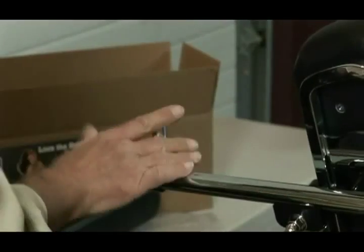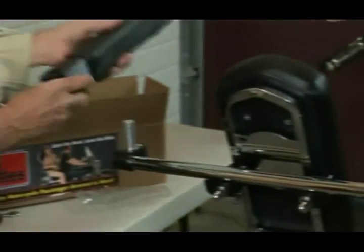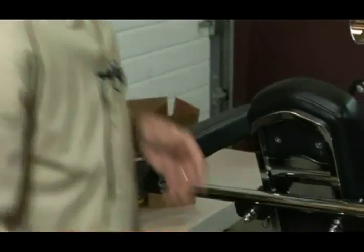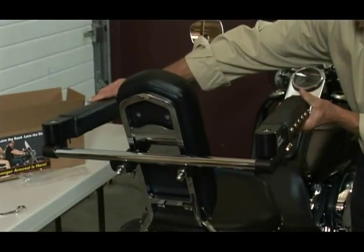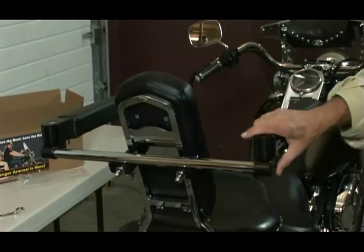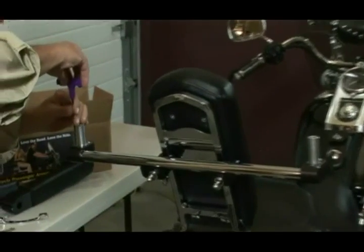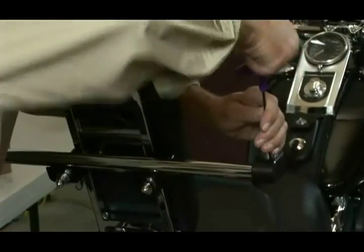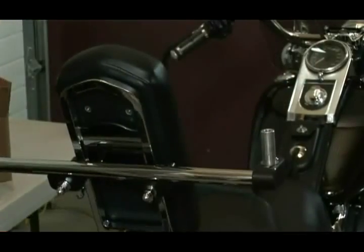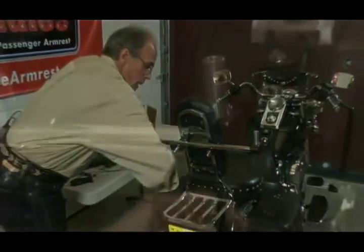Those are tightened a little bit. We'll put on the right armrest and the left armrest, and walk over to make sure that they're parallel. You can adjust them up and down because only one of those set screws is very tight. Now we're going to take the armrest off and tighten the other set screw very tight, so all four of these set screws are really clamped in there. They actually have a point on the end of them, and that point digs into the cross tube to keep them really solid. There's also a clamping screw underneath — you're going to tighten up these clamping screws really, really tight.